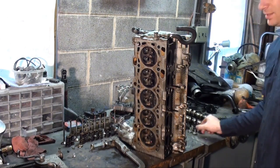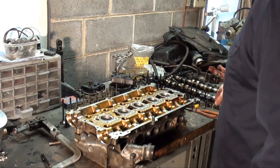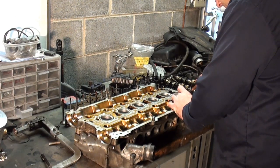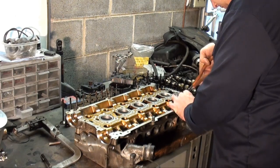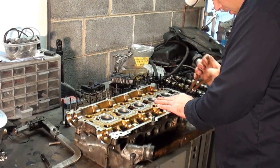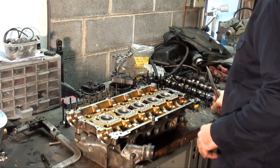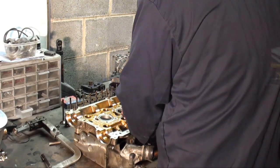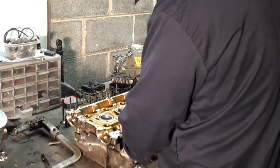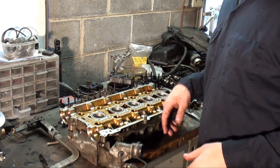It's all of them. There's 20 of them all together. There's 10 exhaust and 10 intake. These valve seals could be a real pain. I'm just using a pair of long needle nose. Just wiggle and get them moving. It's like once you get them moving, man, they come right out. Okay, now I got the valve seals all removed.